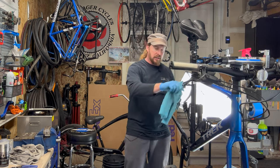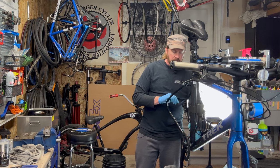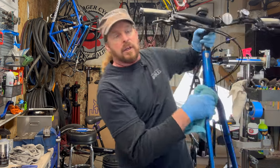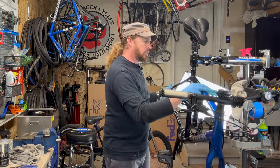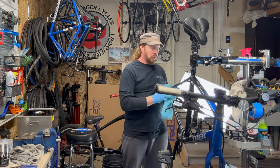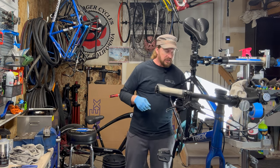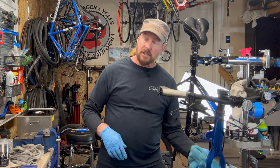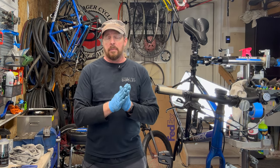Able to get into all those nooks and crannies and all the little tough spots — all the dirt that splashed everywhere. Cleaned inside the calipers with rubbing alcohol to get all that grit out too, and the rubbing alcohol will dry so it doesn't contaminate any pads. You want to be careful what you use around hydraulic pad pistons. I use rubbing alcohol then burn the pads with a small torch — it burns off all the contaminants or any oils that may have gotten on them. Cleaning the pads and the rotors will definitely bring braking back — probably better than it was originally, because original pads have a coating and had to break in. These will already be broken in and cleaned, so they'll probably perform better than when new.